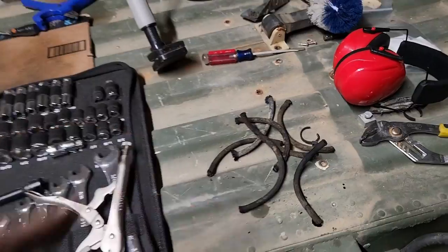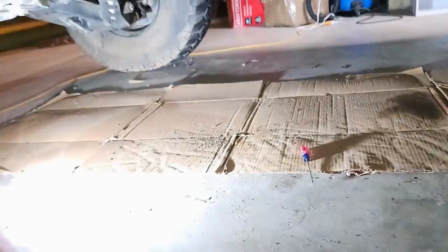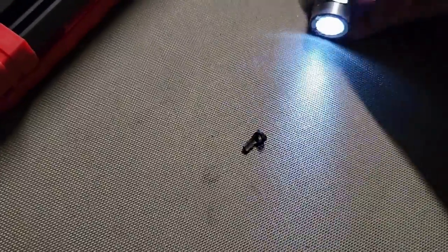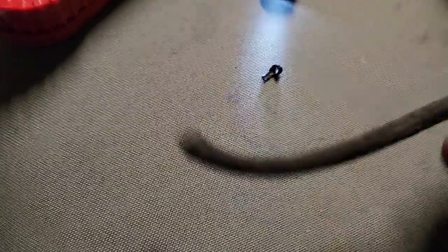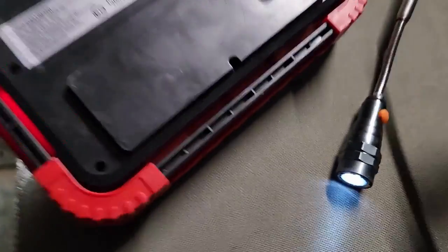All right, I got all of them swapped out now — there's my pile of old ones. Let's see if we can start her and see any fuel leaks. We got her on — very noisy in here obviously — but if I look underneath, no more fuel leaks! You're probably wondering what was happening with the fuel leak still after I replaced all the hoses. It was really starting to frustrate me. When I pulled off the original hose, stuck on the injector nipple was a rubber piece that had shredded off of an old hose, and it kept me from seating my new hose properly. Got that taken off, got all the hoses replaced — no more fuel leaks.